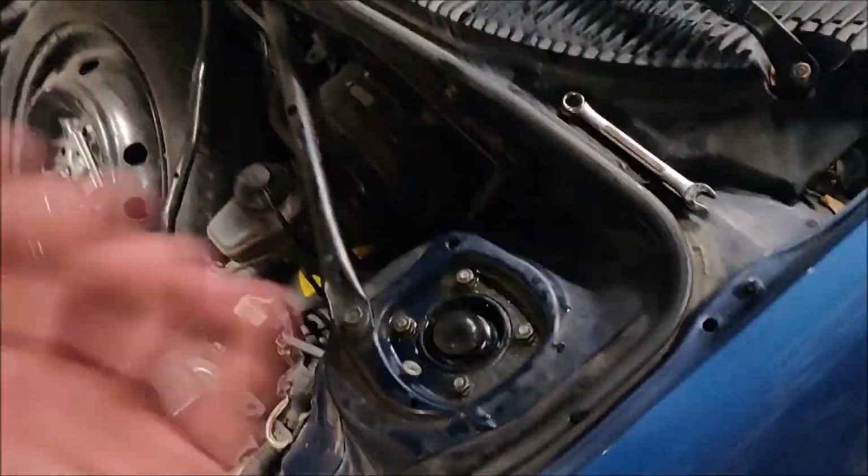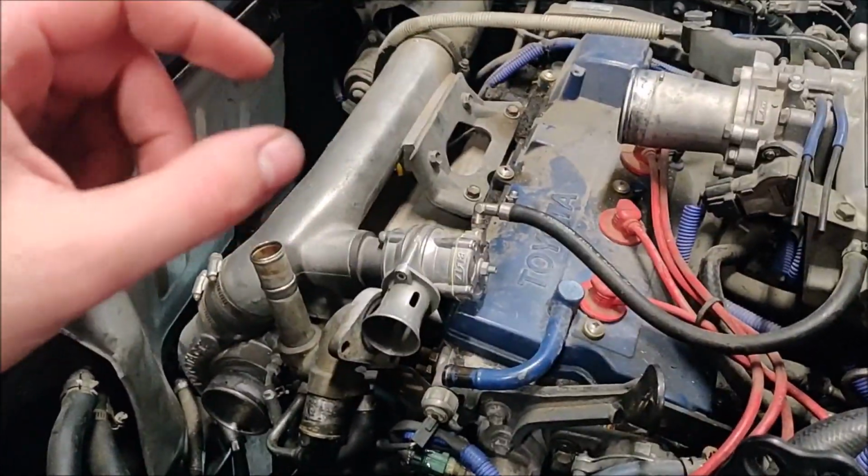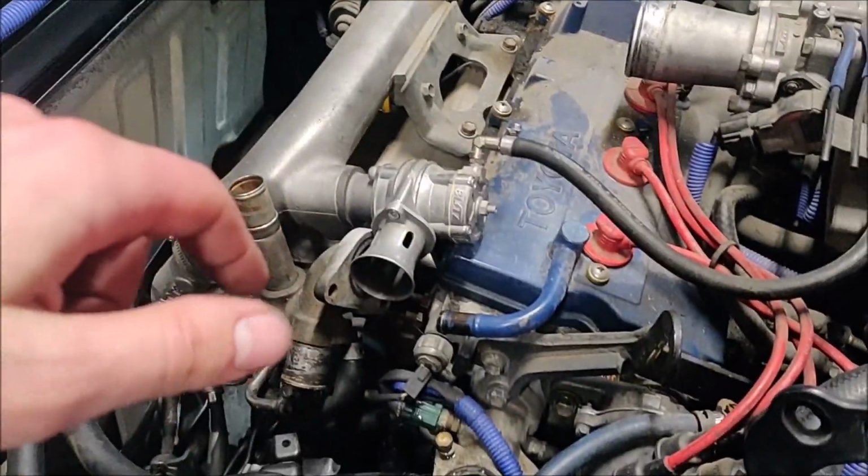So with the clutch, we did end up getting it bled, and it seems fine. Might give it another bleed after a while to let any more air bubbles consolidate. But the clutch pedal actually has some feeling now. It depresses the clutch fork probably about an inch or so. It doesn't spring back quite all the way. Well, it will, it just takes a while, but it'll come back most of the way. That may just be adjustment issues, though.